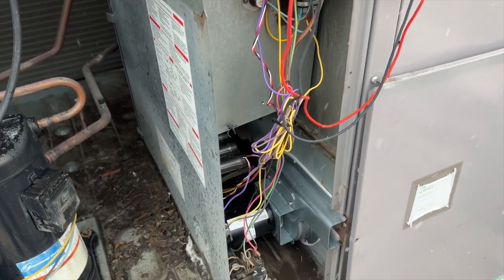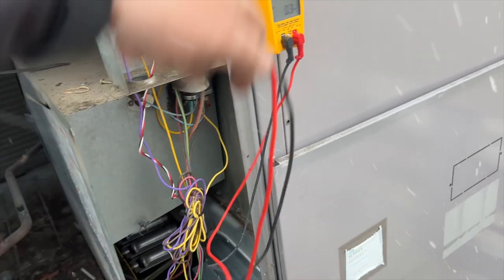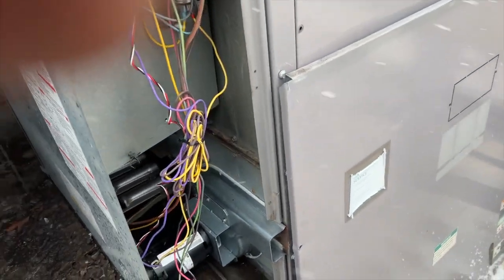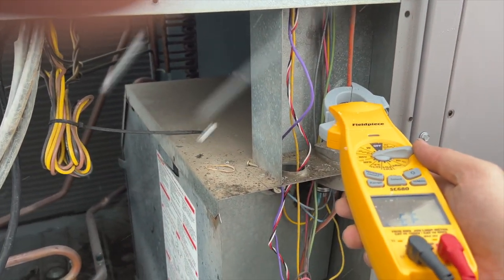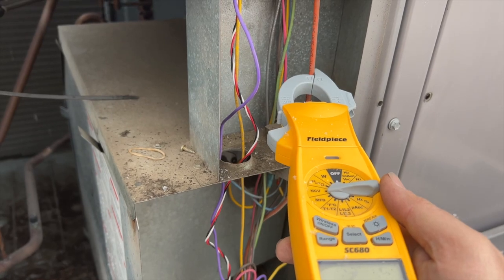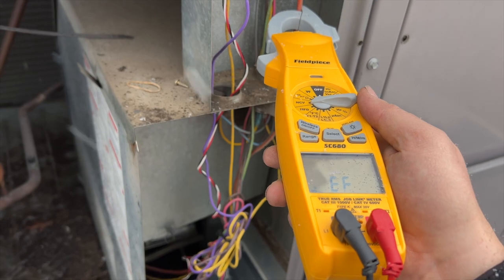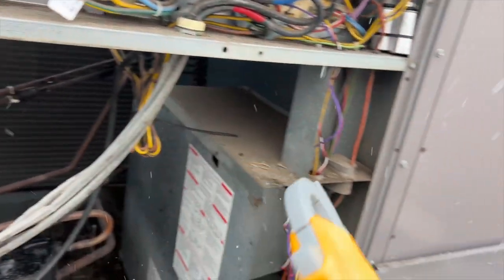I just smelled gas but we didn't get ignition - that's a little scary. Hopefully the ignition system is working. A cool way to check if your igniter is getting power: use non-contact voltage and hold it up to the wire going to the igniter assembly - it should start beeping once power is going through. If not, we know we have a bad connection or the igniter is bad. The gas valve is working because I do smell gas. The igniter is not sparking but we are getting power, so we need to check that igniter - might be dirty.